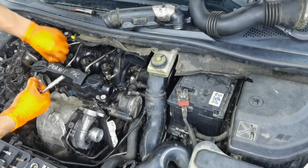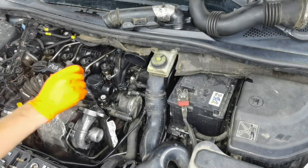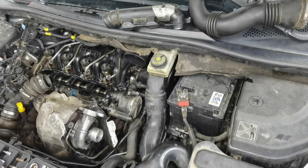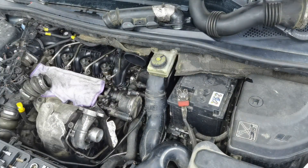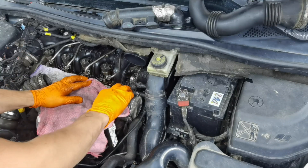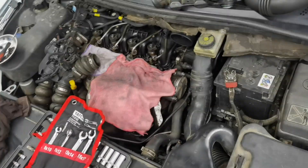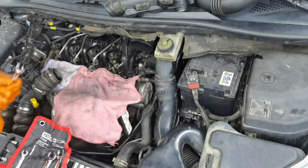As you can see, after I'm done removing all the necessary pipes from the turbine, the camshaft cover came out very easily. I recommend you to take a piece of cloth or something like that to put over the camshaft, because you don't want anything to fall into the engine. If any tool or metal part falls into the engine, most likely you will destroy the engine.